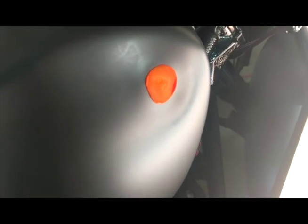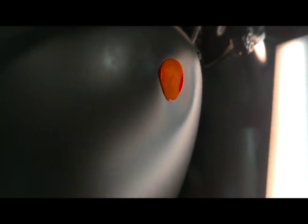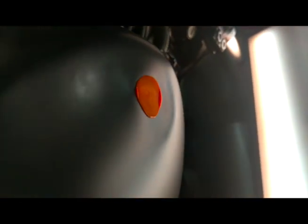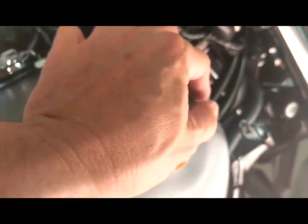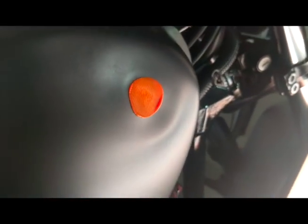You could see I got a lot of it out right there. It's crowning up again. From my first pull, that was my first pull. So I'm kind of working down towards that, and what I did was I knocked this crown down, and what did I use? I used my Craftsman hammer and my tactical ball. So by doing that, I'm not marring the paint and making it shiny. So there's a little bit of a sheen there, but that's just rubbing right off, and some alcohol will take that off as well. So I'm going to continue going here.